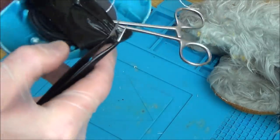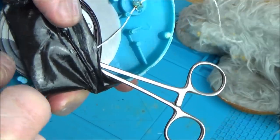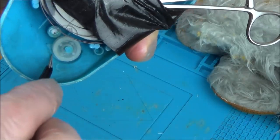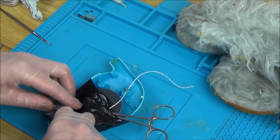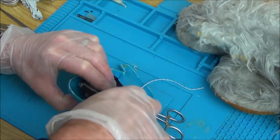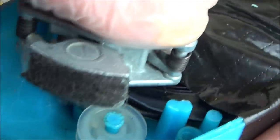Right, so the belt goes like this. It goes round underneath the big record, you can see it down the bottom here, and then this particular part here, let me just get it out without damaging it, it goes just into that clear pulley like that there. So it doesn't go around the pulley, just goes this side here, and it goes around the governor. So what I'm going to do now is I'm going to drop the governor into place. Basically it goes like that there at the bottom, you see? So it doesn't go around that pulley at all, that just keeps it in place.